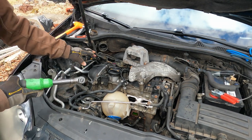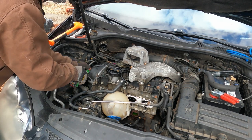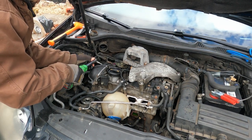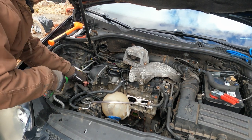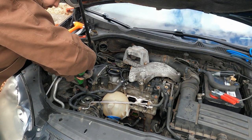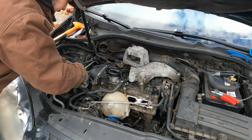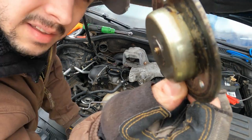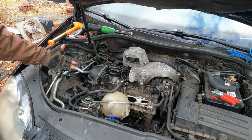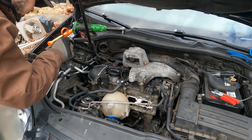And then just be careful tightening these bolts down. You don't want to over tighten them because they could break pretty easily. Feel that goes in and out. That's what actually actuates your camshaft. So that pushes on the end of that spool valve and controls the oil flow in and out of the camshaft. And then don't forget to put your dipstick in.